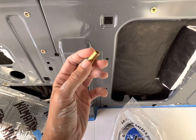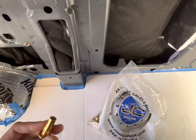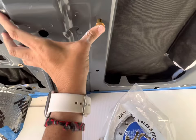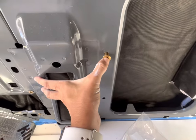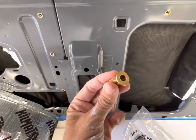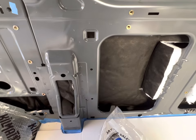These are the quarter by 20 pre-bulbed cross nuts from JC Sales and Rivet. These did not work for me at all — they did not want to go into these holes without hammering, and I did not want to do that. It's not recommended, so these did not work in the walls at all.